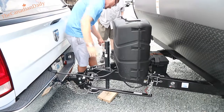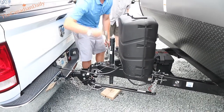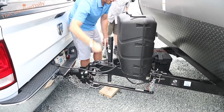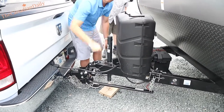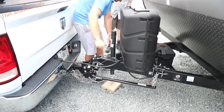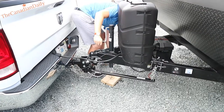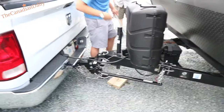It'll load the tongue weight onto your frame equally as well. I like to get the jack above the torsion bars because if you hit anything it'll just work like that — act as a buffer. They're not the same as sway bars. A sway bar would be attached on a ball and then mounted to the side, friction controlled.